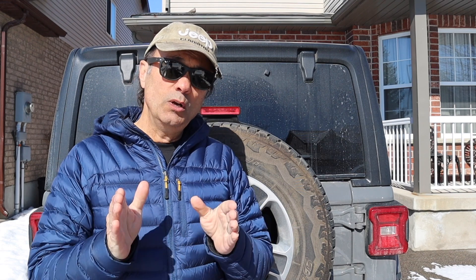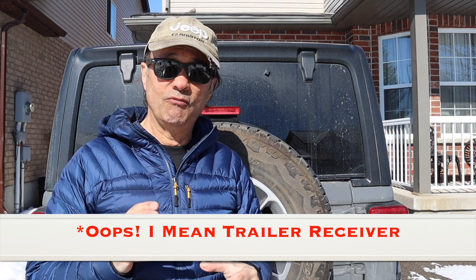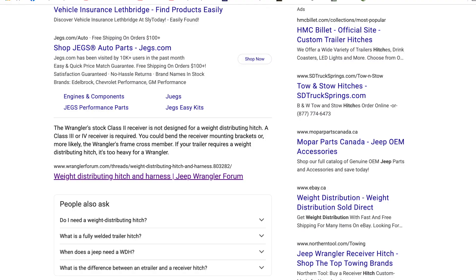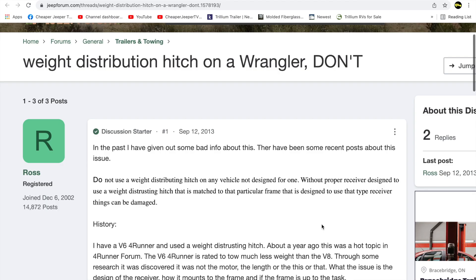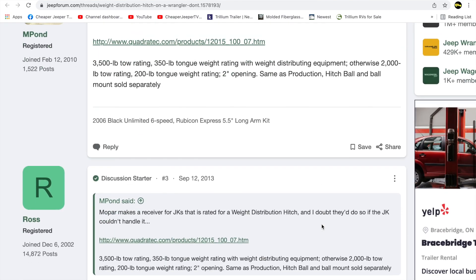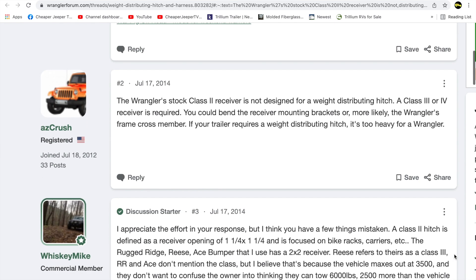In the tip segment of this video, I want to speak with you about the trailer hitch of the Jeep Wrangler. It essentially is a trailer hitch that's bolted onto the bumper — four bolts holding the trailer hitch to the Jeep and towing your trailer. A simple Google search on Jeep Wrangler and weight distribution hitches will lead you to many threads that share how the stock trailer hitch on a Jeep Wrangler is not suitable for the torsional stresses put upon it by a weight distribution hitch. So if you are towing at the maximum capacity of your Jeep and considering a weight distribution hitch, make sure you use a Class 3 receiver connected to the frame members of your vehicle. I'll put a link to a few of the forum threads in the description section of this video.